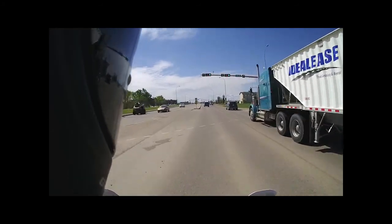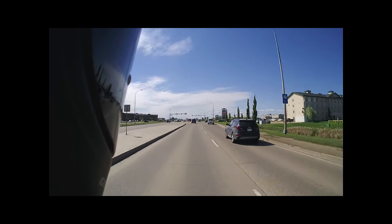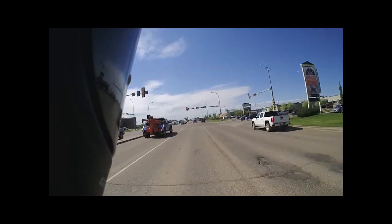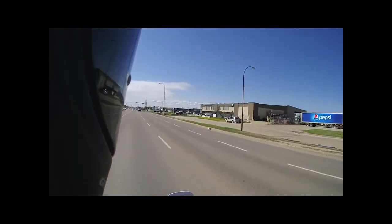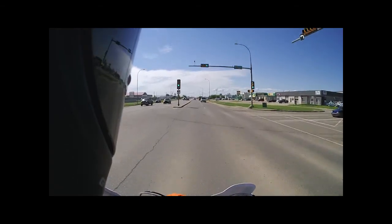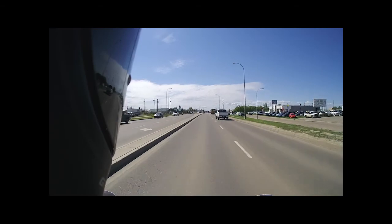I did notice that on these bikes at idle, the stator does not produce enough. Well, it produces power, but it gets really dim. So if you're sitting at an intersection with your signal lights on at idle, they can barely be seen. You can see right there, when I'm trying to hold a steady speed, this thing is just on-off. That's where the cush drive would be nice. So it's not ideal for just cruising down the road. It just wants to go fast or stop fast.